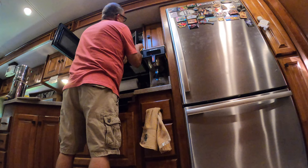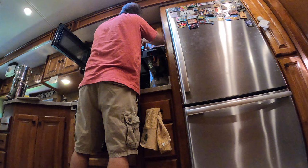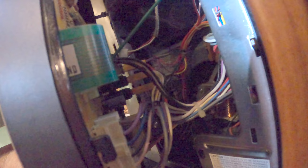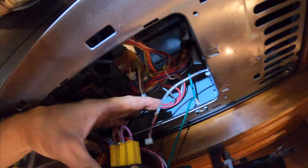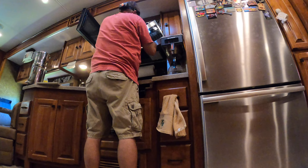I'll get my headlight. The hard part is getting to the fuse, which is back in there, because this thing is always in the way. Let's see if I can get the camera in there. So the fuse is right here. I'll have to put the camera down to do it, but you've got to pop the fuse out and then put the new one in. And I unplugged this wire right here just to make it easier to get at. That's where the little screwdriver comes in.